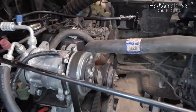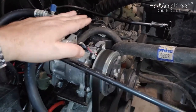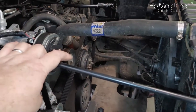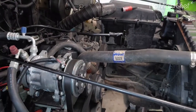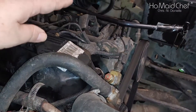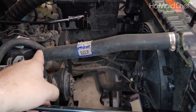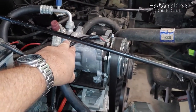On the fan itself, which I still have to rewire — the fan is currently wired to just turn on with the ignition. I did put an aftermarket fan here, which really helps cool down the Jeep; it actually never gets hot anymore. I need to wire in a relay to turn on this fan when the AC is on. The issue is the radiator fan turns on with a ground signal — it has an open ground until the temperature reaches a certain point — while the compressor turns on with a positive. So you can't wire them together; it would be a direct short.